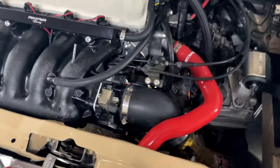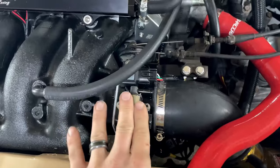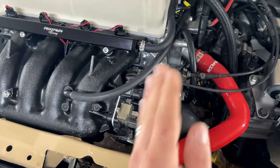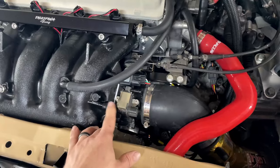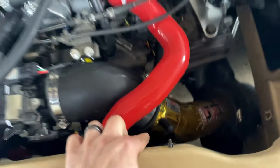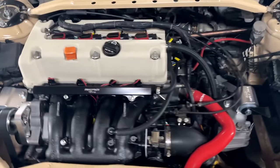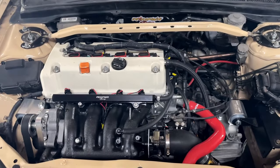The reason it's not staying idling is the air idle control valve is not on the bottom of this throttle body — this one has a block-off plate there. So it's not going to stay idling until it's warmed up; we basically just have to keep our foot on the throttle right now. We need to get an idle control valve on there for it to run properly, and an air intake temperature sensor. Everything's looking good — it sounds really healthy. The throttle response is there. It sounded really crappy on camera because the mic distorted, but it definitely sounds good.